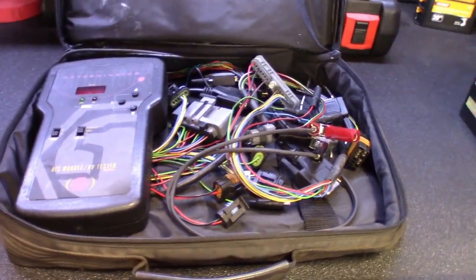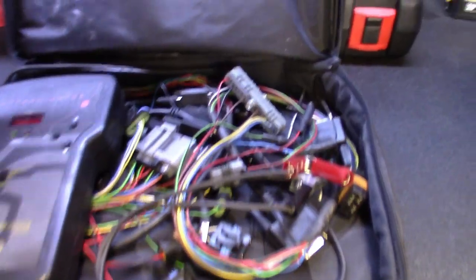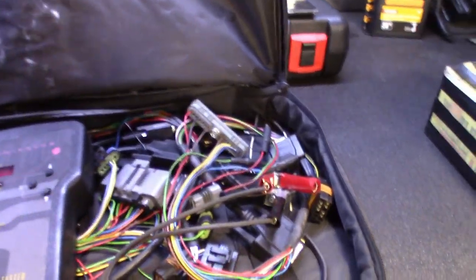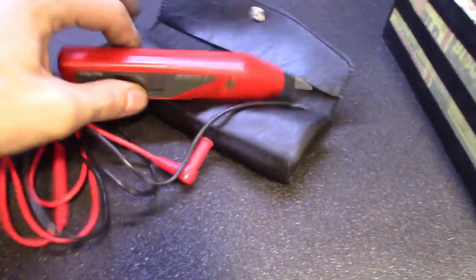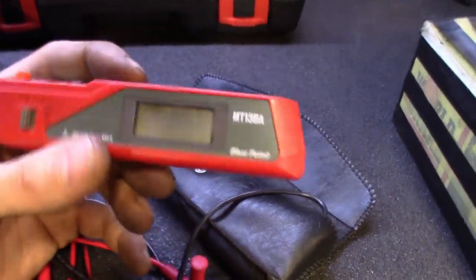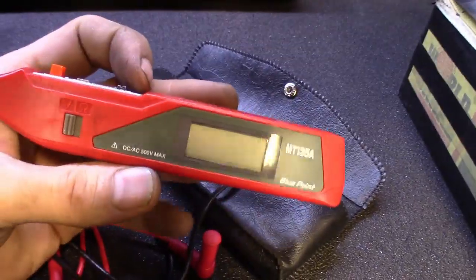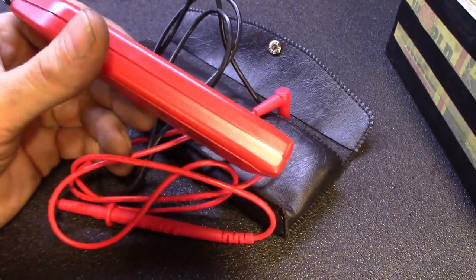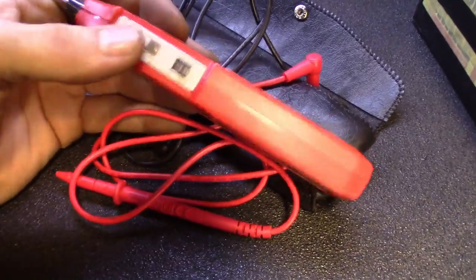I still use this thing — maybe a month ago — making quick work of a job. I probably could have figured it out some other way, but this was the fastest way. Still got the instruction sheet; it's a great little kit, definitely got my money's worth out of this tool. Then I've got the old-school digital probe — part number MT135 — for fast checking circuits, checking fuses. It's like a mini multimeter in your hands. It checks ohms, checks voltage. This was a great little tool, before power probes, and I still use it now and again but I refuse to retire it.